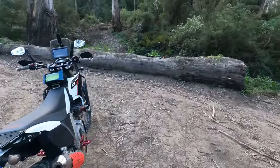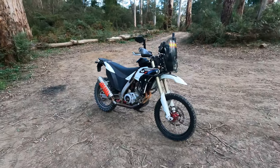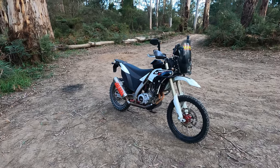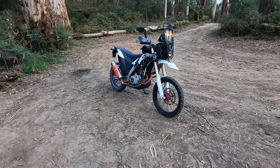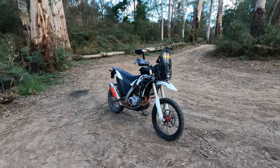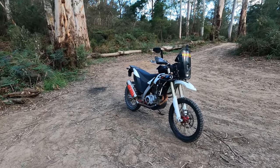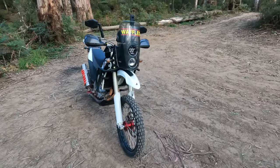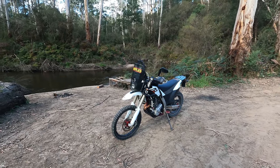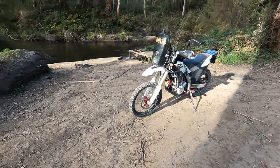The DR has a 43mm front fork; these have a 48mm front fork, same as the 690/701s — so fully adjustable suspension. With a DR650 you're going to have to spend money on the suspension — no ifs or buts. The one I rode had $1,800 spent on it and it was really good. The 2018 690 had stock suspension — it was fine but very firm and very harsh, handling the faster race pace no problems. Whereas the AJP here is very plush and soft, it doesn't handle race pace at all, but it handles the chatter and the corrugations very well. It's designed to be a touring bike, and with the longer wheelbase, AJP aimed the product more as a touring slash adventure bike.